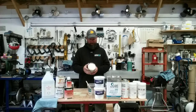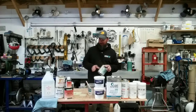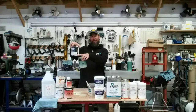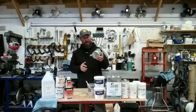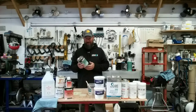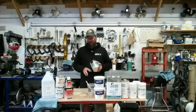After the last coat of paint we went to a urethane clear coat — all made by Axalta under the Montana and Nason names, all compatible with each other. We applied 3 coats of clear, using the entire quart. After that, close up shop, let it air out, walk away, and come back in the morning.